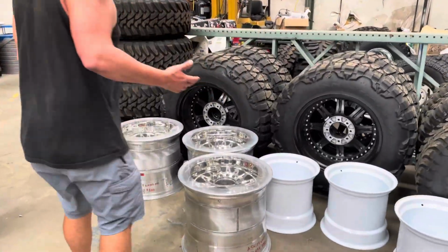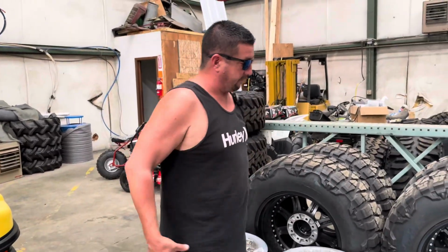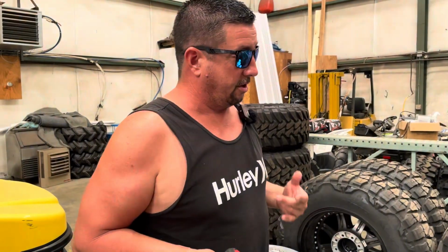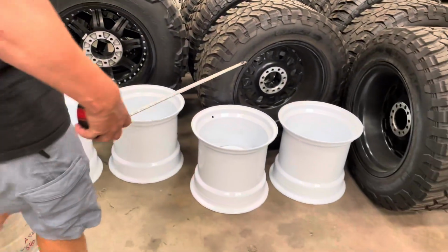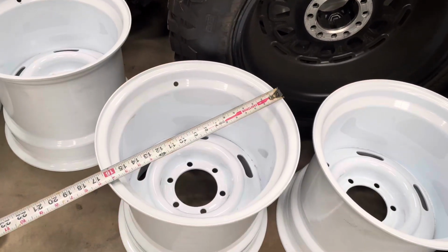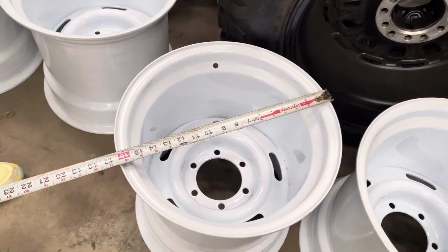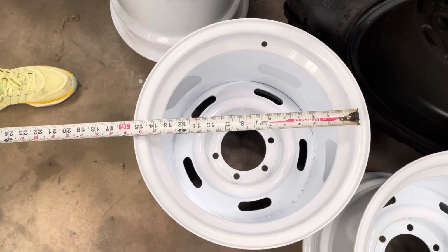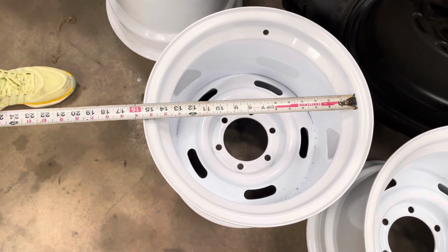The next thing that you've got is measurements of wheels. So you hear some guys say, I got 15x14s, very popular wheel for us. 15x16s, very unusual but popular wheel for us. That's going to take the measurement first number across. Now, you're going to say that's a 16. Anybody measuring that's going to be like, I got a 16-inch wheel. People on Facebook and Craigslist always advertising wrong. I got a 16-inch wheel. It's actually a 15-inch wheel.